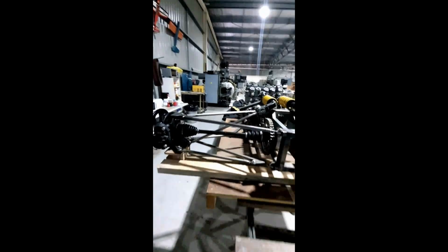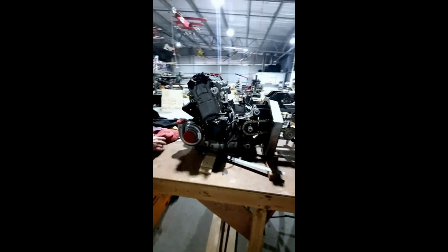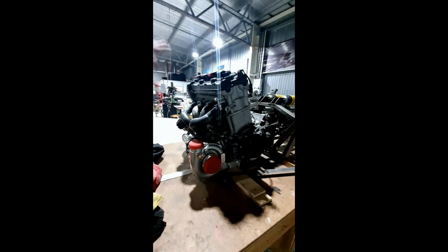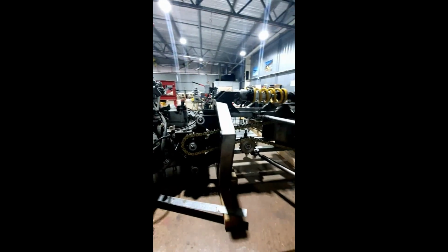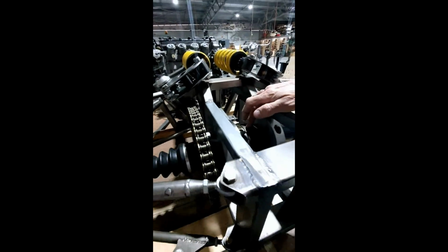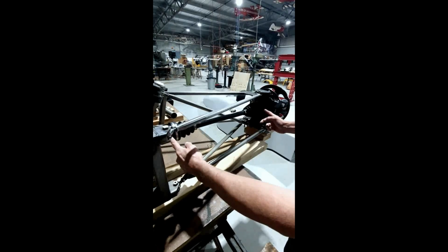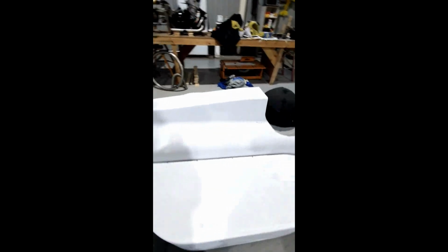Fucking hell. Yeah, so come around here, see how it all works. That's a Hayabusa 1300cc motorcycle engine. These are one of the most powerful bike engines, and I built the turbocharger system for it, made all this manifold here, set it on the frame. So it's got the 6-speed sequential gearbox and chain drive going to the rear end, where I've got a Honda differential in there. So I've taken a limited slip diff out of a Honda, and I've taken the sprocket off, redesigned all that. And I'll put a jam tin around that, so it can hold all the oil. But that's actually a limited slip diff. And then I've taken these Honda drive shafts, which would have been off the front drive shafts of a Honda Civic, and I've cut and shut them and used them on the rear. The brakes I built, all the whole uprights and all that's all been CNC machined. Fucking unbelievable. It took me about 6 months to carve out.